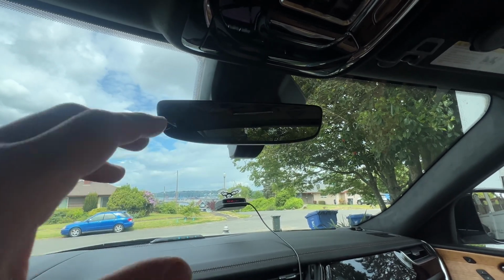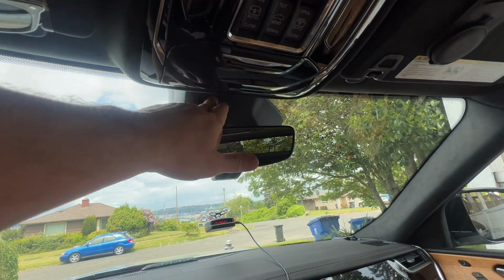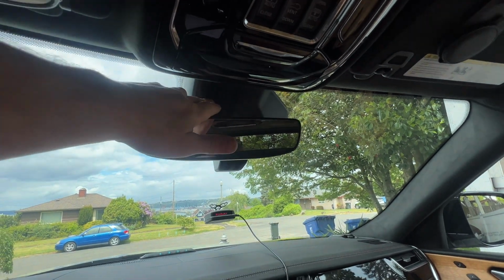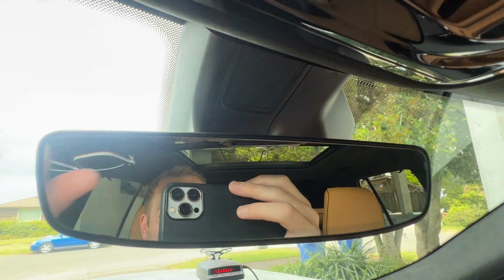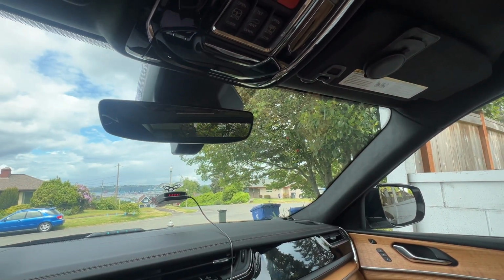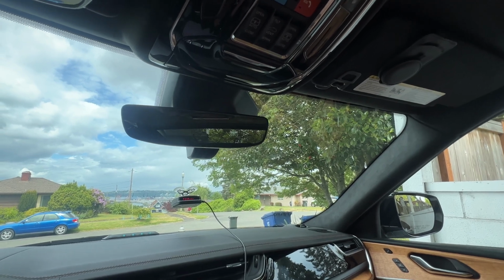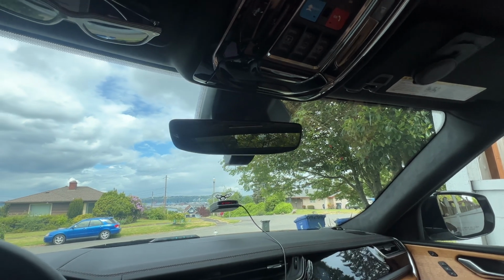Beyond that, once you've connected those 2 pieces, you pretty much reinstall the housing, run your rear camera cable to the rear, if you had opted for the rear camera like I did, reapply the face covering, which is right where my hand is, this little square piece that you would have removed, and you're done. I mean, that's how simple and easy it is. Took me 15 minutes on my Ram. It took me 15 minutes just to get the face cover off. So this install was much easier, much simpler, much faster, and I mean, you can do it in your free time really easily.